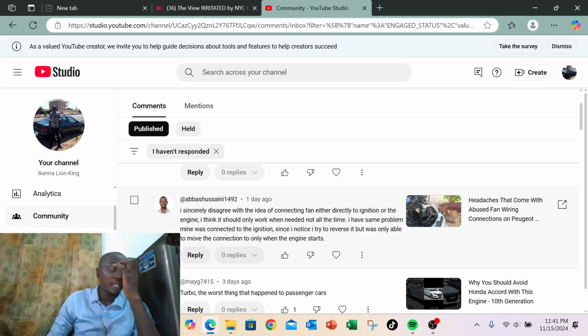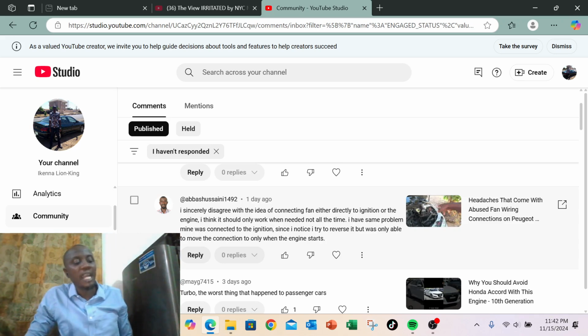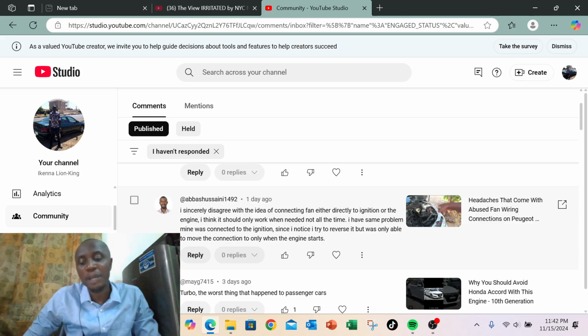However, go and watch the video I did last concerning abuse of engine fan connection. I did a video on 406 recently, published it. So go and watch that video. You could see the consequences of some of this. It's possible that your ECU itself has even been affected. I don't know. So you won't know until you reverse it. Even with a scan, you won't know until you reverse it. Then, if it doesn't work, it means your ECU has been toasted by the wrong wiring when they did that bypass, or even at the point of trying to reverse it.